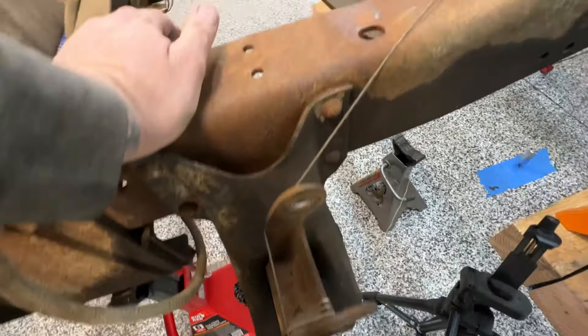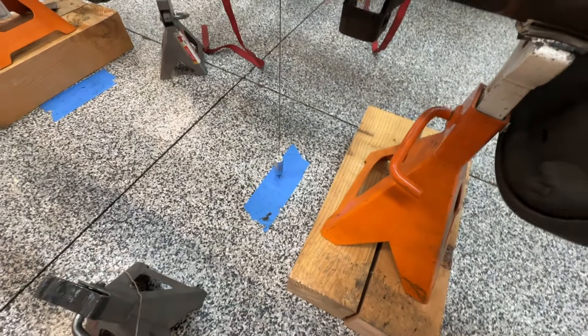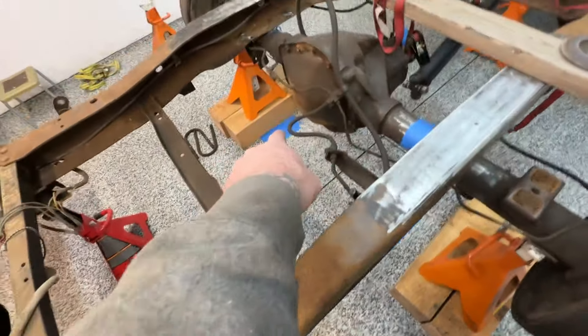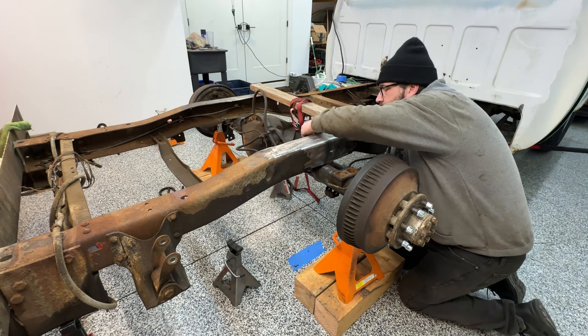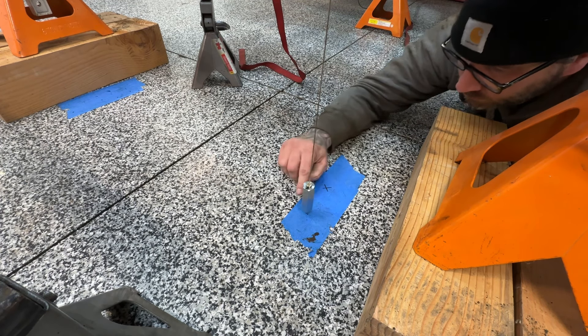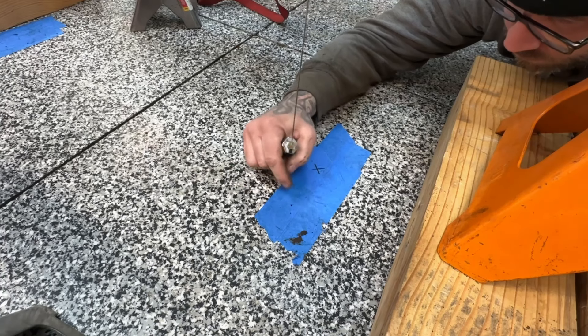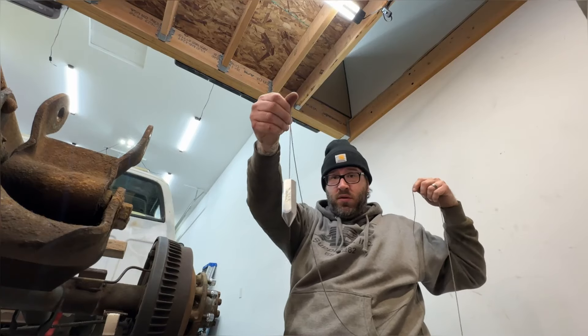I'm going to check the back of the axle coming down the other direction, and I'm going to do the front and back. Now we're on the passenger side — let's take a look. That is money. Got the string wrapped around the leaf mount, going down, wrapped around that axle. Let's do the back side of it too, and then we're going to be good to go. You can see right there is my sharpie mark. I say that's money, guys. I may have lined this up off camera, and it might have taken me about three hours to do it. Just be aware — it takes time.